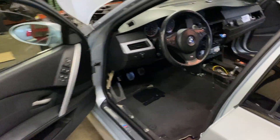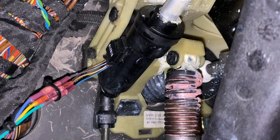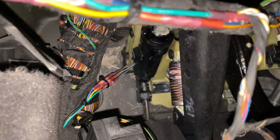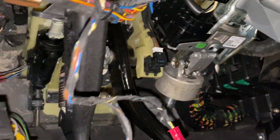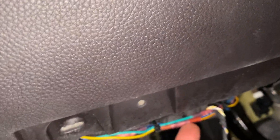I also did the clutch position sensor today. There are four pins on the clutch position sensor — there are the four wires going to it, heat-shrunk terminal connectors. Three of the wires go into the CAS, which is the general module, and that's up there.